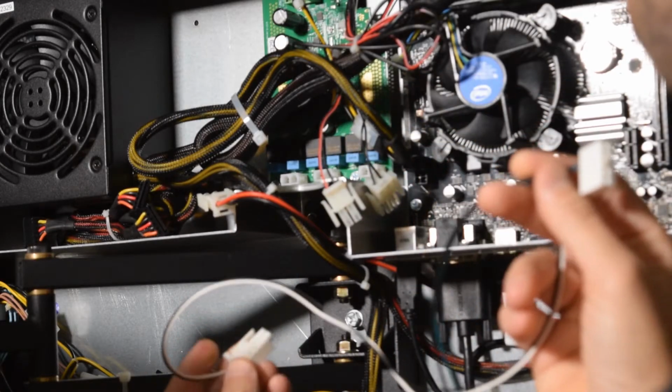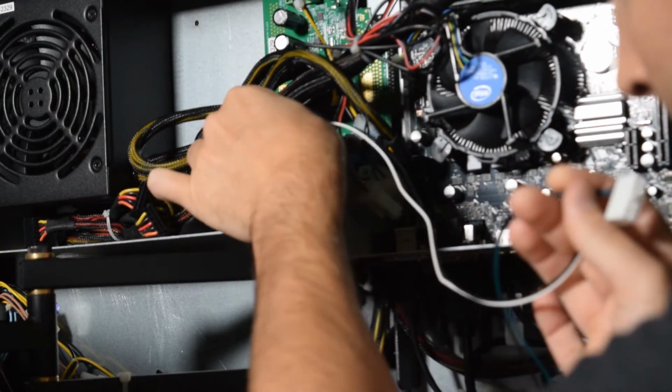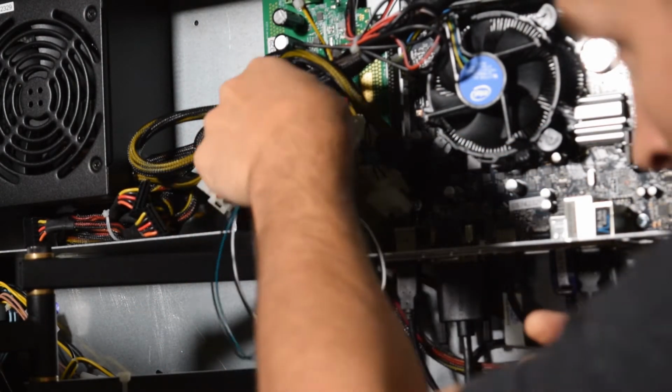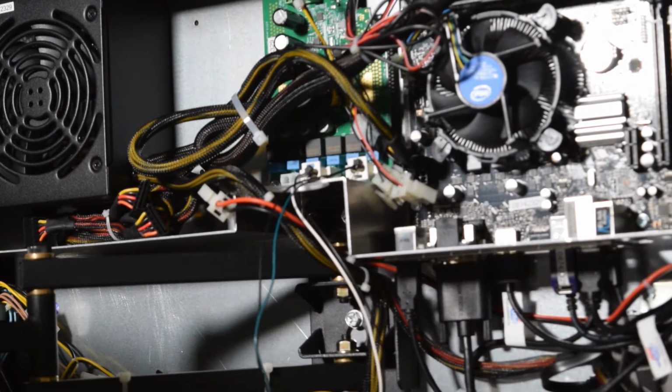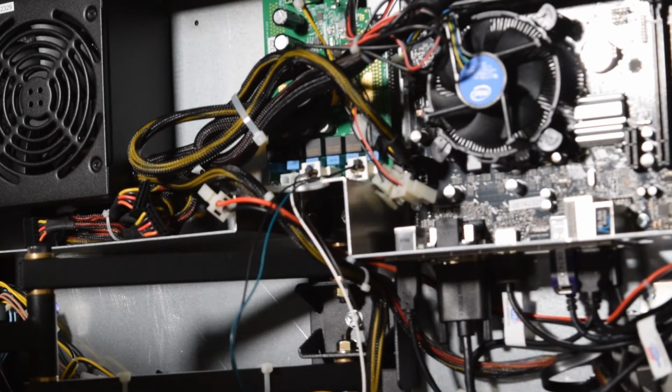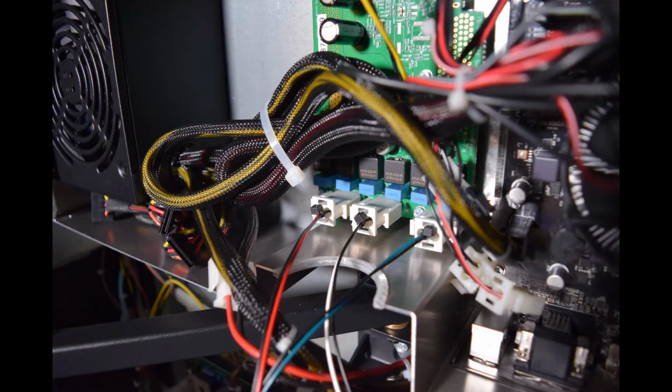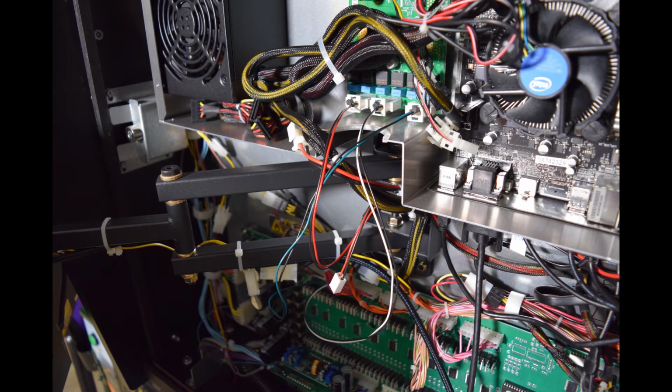Now connect the 2 ends of the Y connector to the soundboard. The white wire group should connect to J105 and the green wire group should connect to J106. Grab the red wire connector and connect it to J104. Here's what it should look like when properly installed.